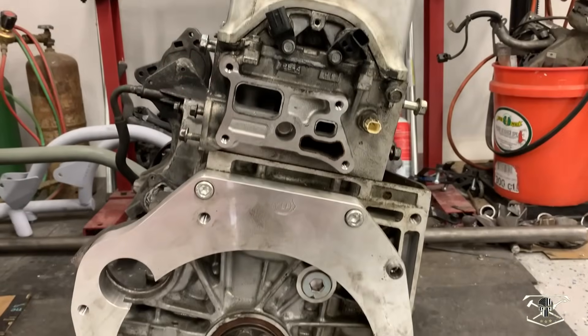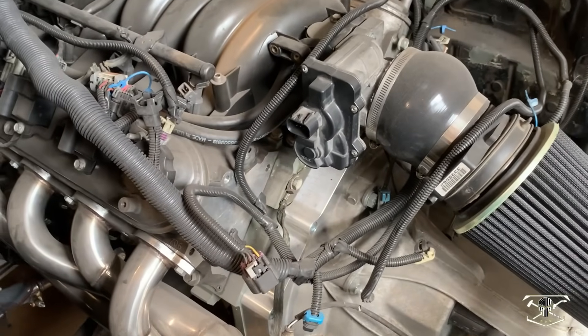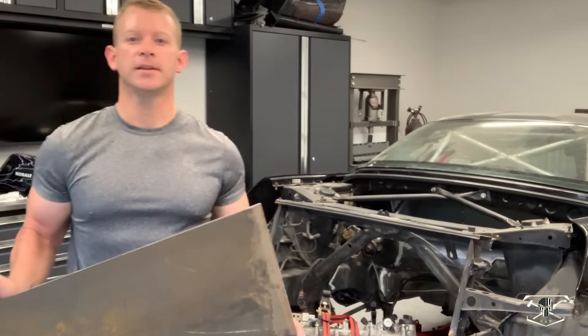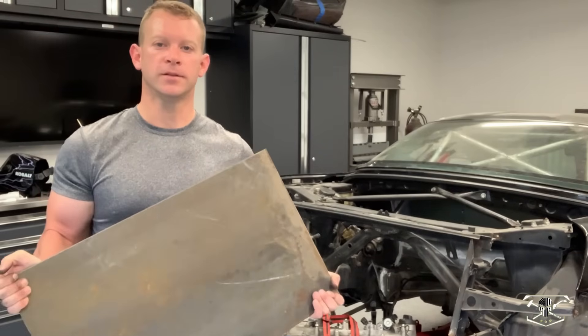In normal circumstances, if you're lucky, you can go and pick yourself up an adapter plate just like this one right here, or something like this that I have in my V8 Swap MR2. In our circumstances, we lack the fancy machining equipment to make a nice CNC aluminum piece, so we'll be using two pieces of plate steel and sandwiching them together. Let me show you my plan.